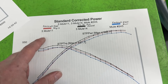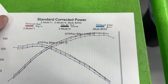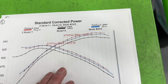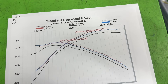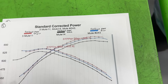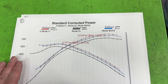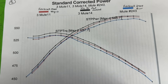In my testing, the 40-grit was better. I will give one caveat though: each time the finishing was done, I didn't try to make the port bigger at all — just changing the surface finish. But inevitably it did grow a little bit — it grew a little when burr finished, and a little more when 40-gritted. What I should have done is another test further after that, just to burr that finish again to see if it kept climbing, because what might be happening is it had nothing to do with surface finish at all and was only because the port slightly grew each time — although the growth is very small.